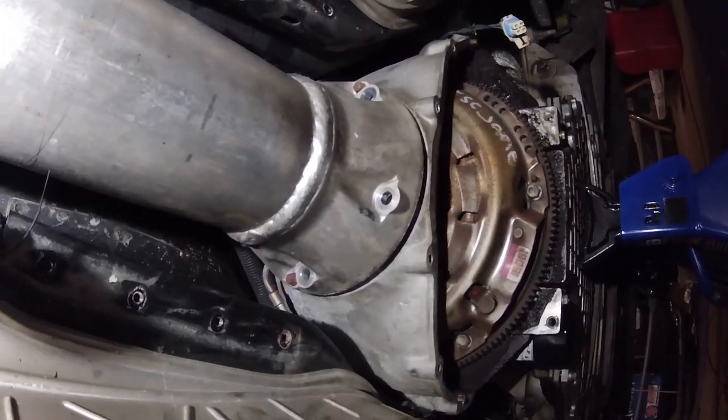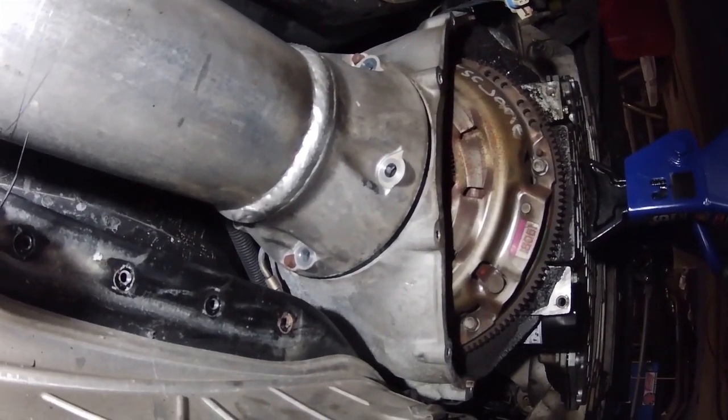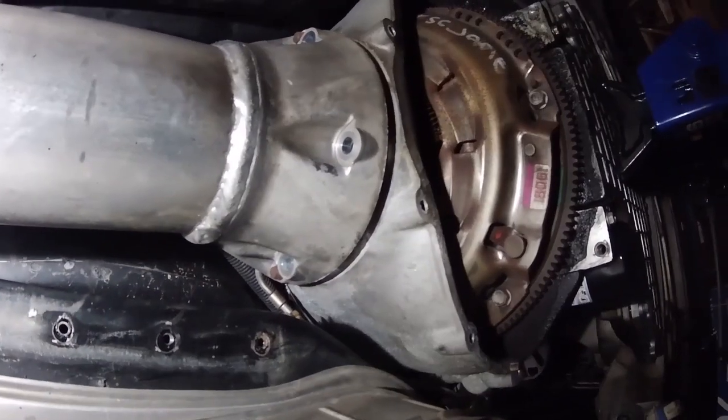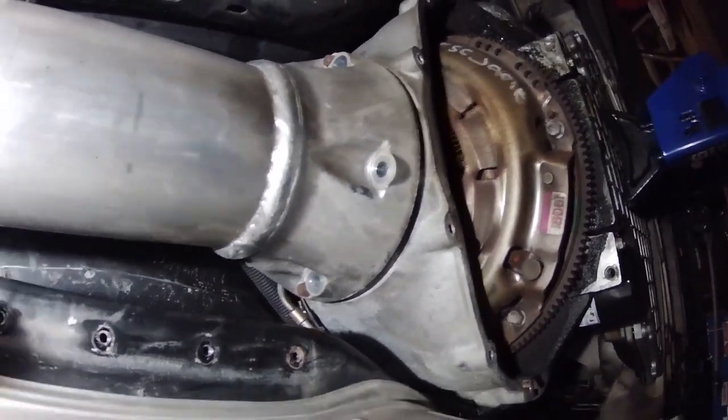All right, now, all I'm trying to do is, I pushed the torque tube back into the back of the engine. And I've got it lined up to the transmission back there. I think I'm going to have to slide the torque tube back, the input shaft to the transmission back into the back of the torque tube so that the shaft coming out of the front of the torque tube will clear the bell housing, and then I can drop the whole assembly out of the car, finally.